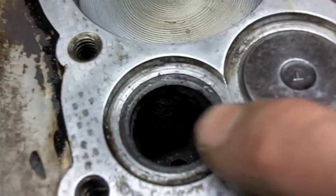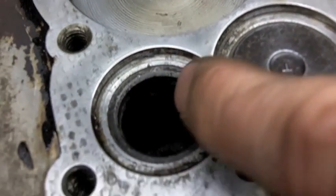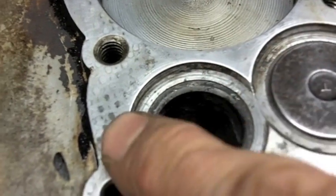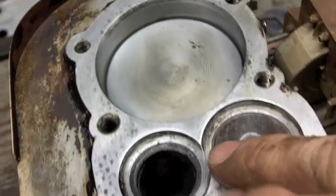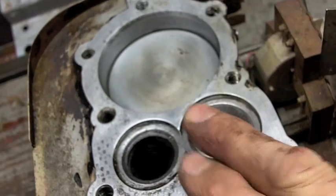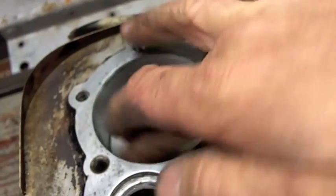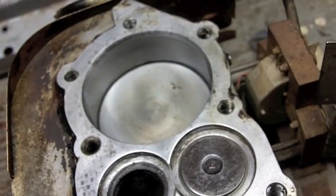I didn't need to show you footage of that. Here's what the exhaust valve currently looks like. Yeah, it's kind of pitted. That's where it seats, and it's got pits and stuff. I shot some oil just for fun. I shot some oil into the cylinder again. It raised the compression a little bit, but not enough to make me think that the rings are worn out.